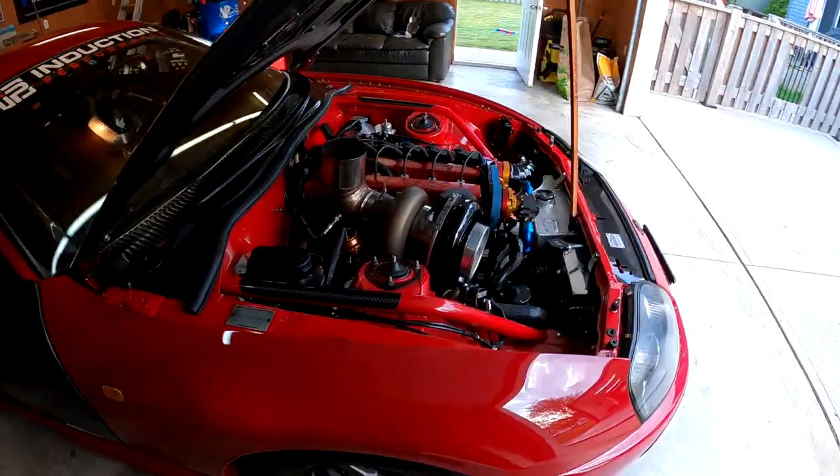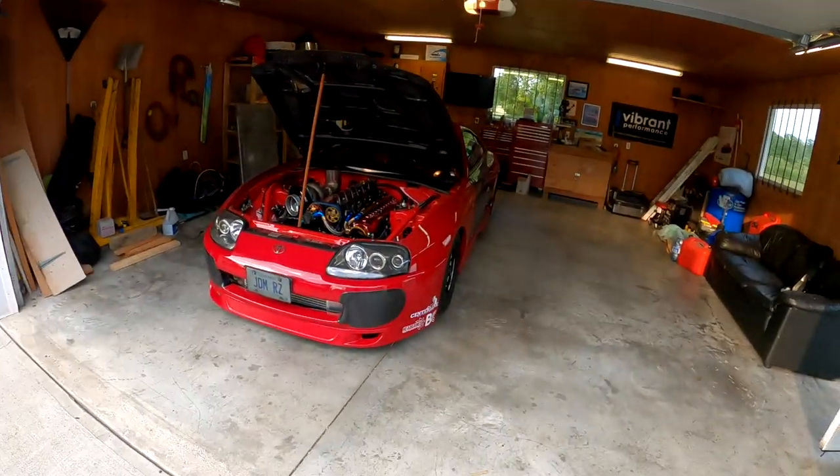Pretty excited — so Sunday we're going to put it to the paces. I got a strategy. We're probably going to do a 60 foot hit, just make sure the car goes straight. If the car goes straight, then we'll go at least maybe 330 or eighth mile. It's still turned down — we're going to start at about 25 pounds of boost, probably around 1400 horsepower. The main objective is to make sure the car goes dead straight. If it doesn't, we're going to have to play with the upper bars, the four-link bars. But she's looking good.